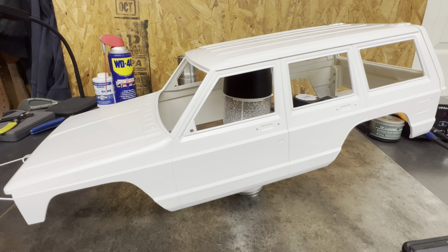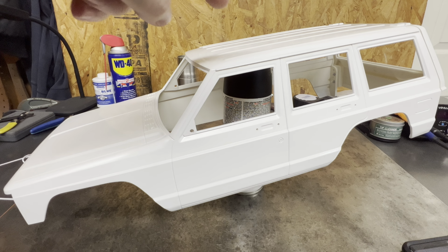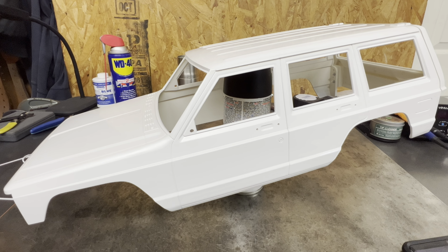It takes a lot to cover up anything with white. Keep that in mind. That white really is tough to cover up. Gray or anything other than white. It's even tough to cover the white itself. So just think of this. If you got to the base coat, which meaning your paint color, and you haven't covered that gray up, you're going to fight that same battle with your base coat. It's not going to cover any better than this primer is.